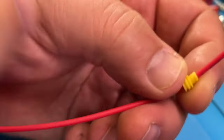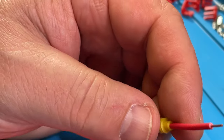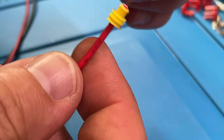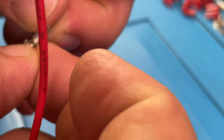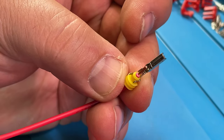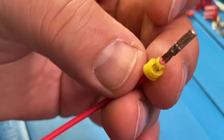Let's try this again. Let's put the silicone over it first, then get the insulation off. Now move the silicone back. We need the female pin — this one is already bent, let me bend it open again. So it goes in here like this. I use my pliers again to get them a little closer together.